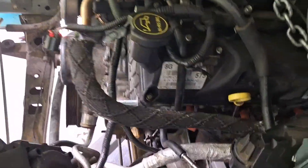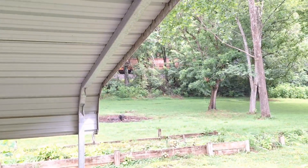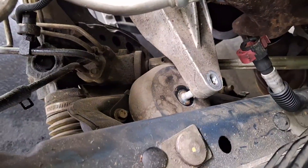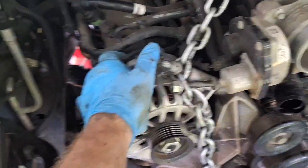Now it's hitting the jack holding the transmission up. Coming in from the right side — that'll work. Don't forget to take the motor mount bolts off on each side. I've got a 15 millimeter bolt out of the bracket for the ignition coil, and I've run a longer bolt through there with the chain looped inside. That bolt is a pinch bolt from a Ford Focus. On the other side I've removed the alternator cover and looped the chain in there. Now I'm going to pump up the jack and pull this engine out. The chain goes underneath the bracket for the coil, not on the outside.